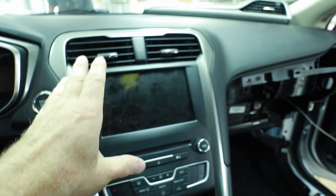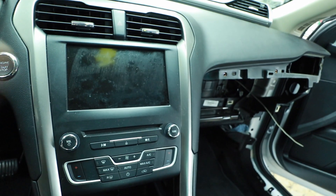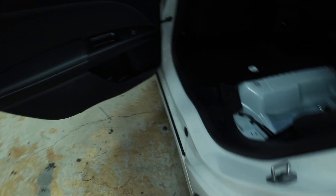This particular car, it's nothing special. It has an eight inch touchscreen, it has tweeters, and speakers in the bottom of the door. But nowhere on here does it say Sony or B&O or anything else. However, we have a speaker here, speaker here, and a speaker here. There are also speakers up here in the rear deck. That's way too many speakers to be powered off just a simple radio - even factory it's four speakers typically.